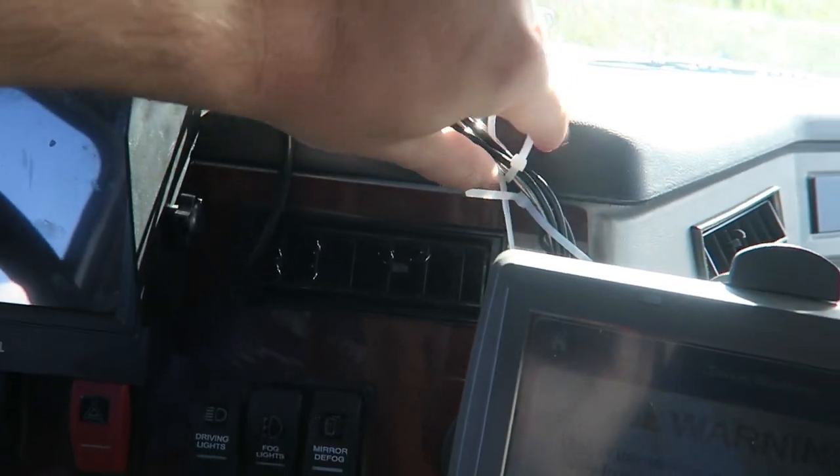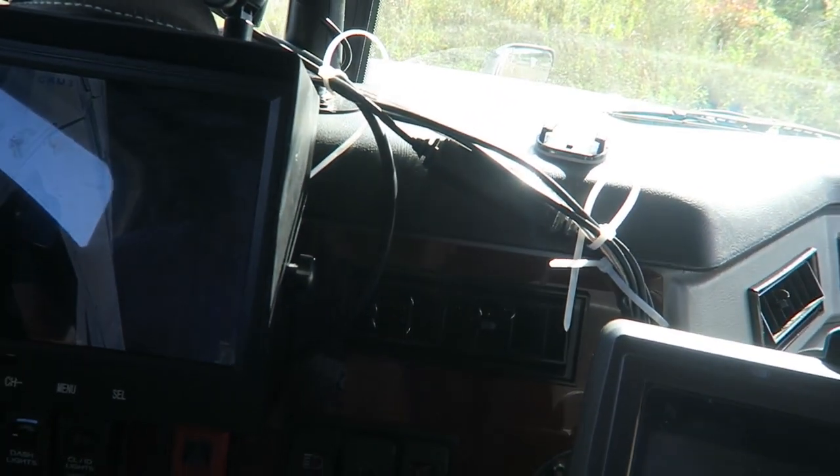It's not the neatest, but remember I don't want to put any extra holes or anything into this dashboard that is permanent. Once you have the wires to your power source, your kit comes with two mobile jack plug-ins with a little plug at the end. What you're going to want to do is cut that plug off at the end — the small plug, not the big one. Don't cut it off right near where it plugs in; you want as much wire as possible. Expose those wires — there's a red wire and a black wire. Red wire is positive, black wire is ground. Connect the positive wire to the positive wire of the camera and the negative to the negative, and plug her in. Presto, you have power to your camera.